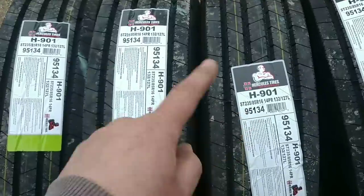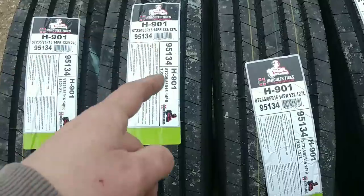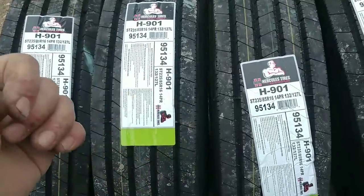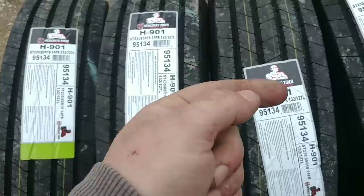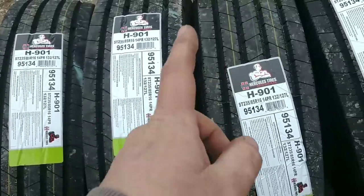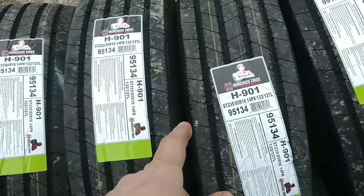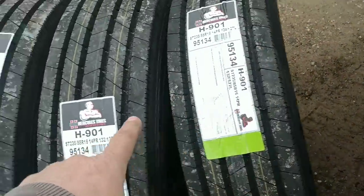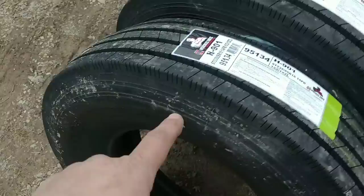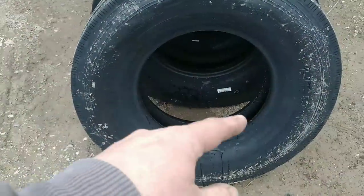new wheels that were good for 110 PSI and 6.5, because the wheels that are on the Durango don't have a pressure stamp on the back of them. The ones that are on Montana did. They were good for 110. The ones on the Durango that we're going to be taking do not have a pressure stamp on them. So I ordered up 4 new aluminum wheels. They should be here hopefully by Wednesday, so we can get these mounted and get them on the trailer.